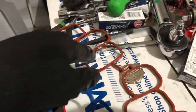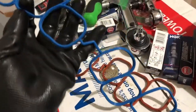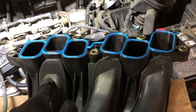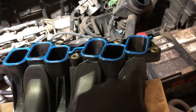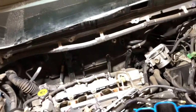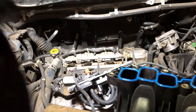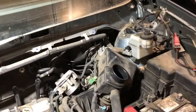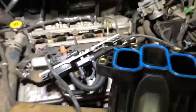Here's the old gasket that came out of the Sienna's manifold, and here's a new FelPro replacement. I'm going to put it on the intake manifold. So: new spark plugs, new intake manifold gasket — now I'll install everything back onto the car. I still need to get that 14mm bolt back in, then tighten it up, put the throttle body back on its two brackets, reinstall the air filter, and then work on the three front spark plugs.